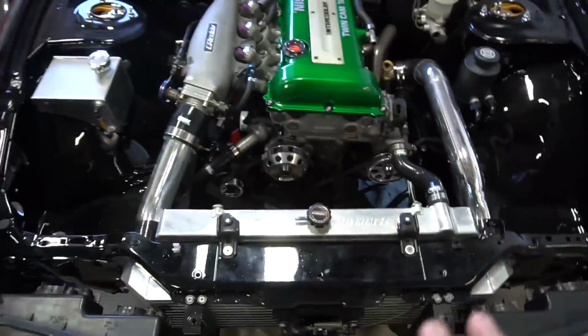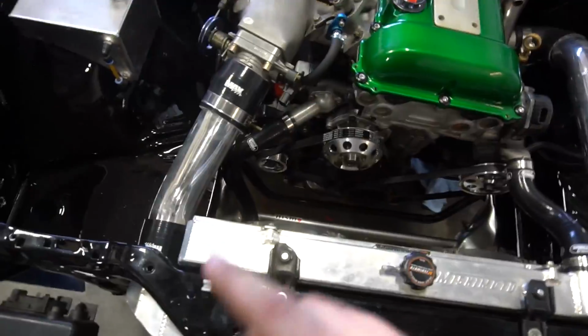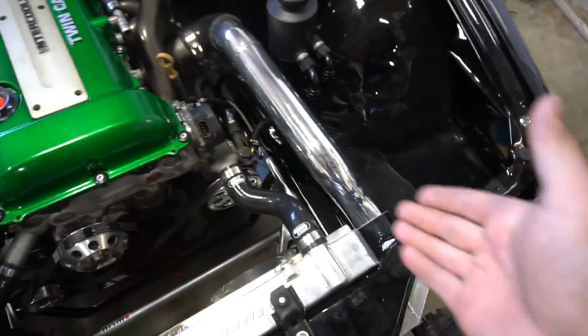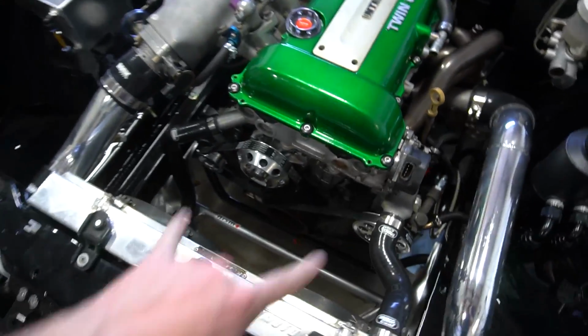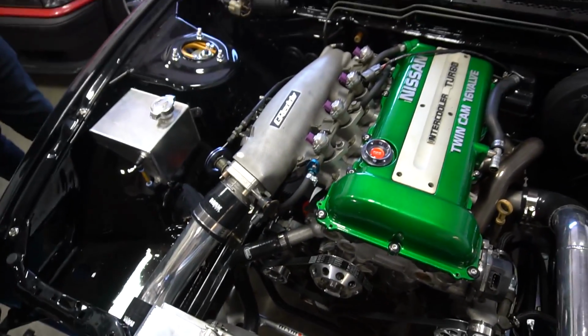I do miss this. It's really starting to look complete, but unfortunately, I have no hose clamps, which I wasn't expecting, so I'm going to have to wait on those. I also forgot to hook up the heater hose lines, which is going to suck doing in the car because it's behind the head. Went to put them in, and realized that I bought the wrong swap hoses. I don't know if they're wrong, but they just don't fit on the heater hose outlets. They're too big. So I've got to order those and get them in, and hopefully we'll have them by the weekend. But besides that, everything's going pretty smoothly. Got the coolant hoses in, and there you go.